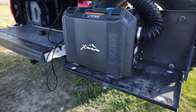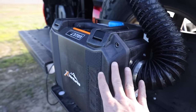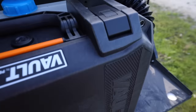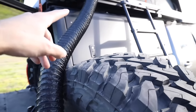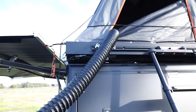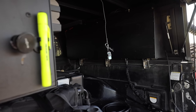Here's a quick overview of my layout and how I set it up at camp. I have the diesel heater right on top of the ultra table, which keeps the heater and that extremely hot area off the floor so it doesn't affect any critters. We go around — the harness feeds into a cubby where my 12-volt power unit is, and we have the main hose that transfers the heat going into this window. The digital controller feeds through the front window, and the fob I always leave outside so I have full control whether I'm down here or up there.